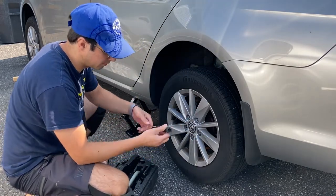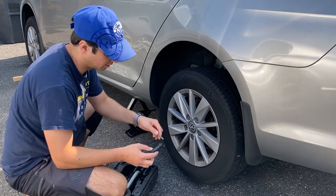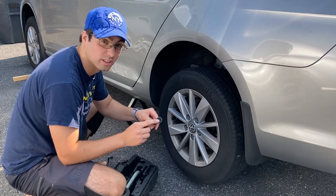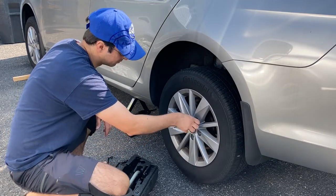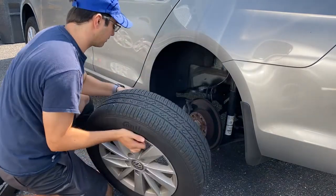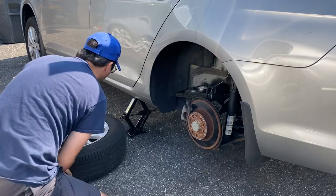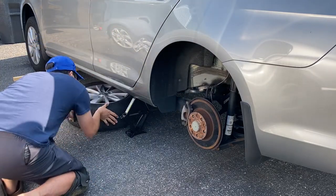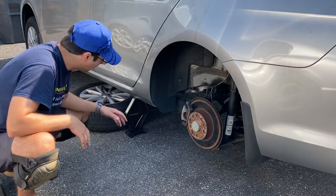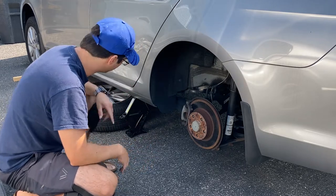Here's what you can take from the tool shop — there's a Phillips screwdriver and a flathead. There's also a nut remover, and that's how you take out all the lug bolts. Now we got to take out the wheel. What I like to do for safety is get my wheel and put it right here — if something happens in an emergency, the car will fall on the wheel. But never be under the car with a scissor jack; if you have jack stands, use them.